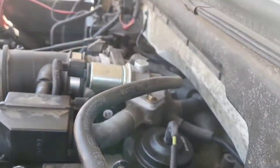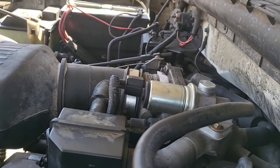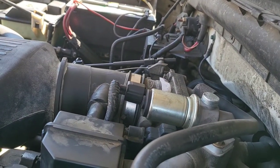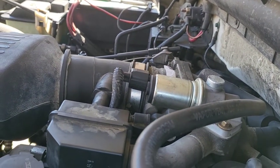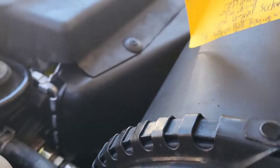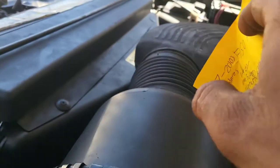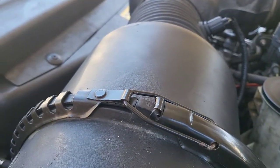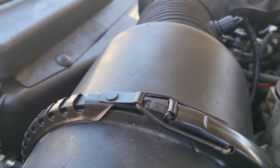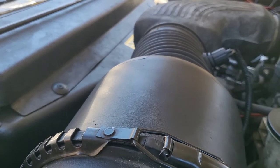The throttle body must be far enough, but some of these cables might be stressed. I might take off the throttle cable — someone said to do that — and the fan, because it might hit inside. So I might just take off the fan over there. Then I gotta get to the bolts after I take off the wheels and jack it up.